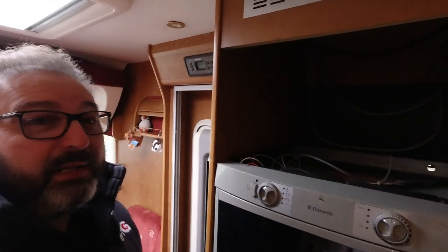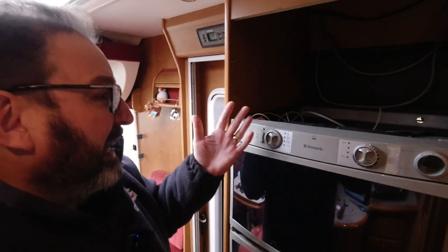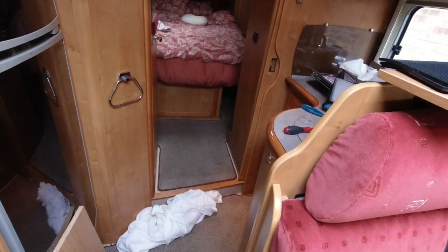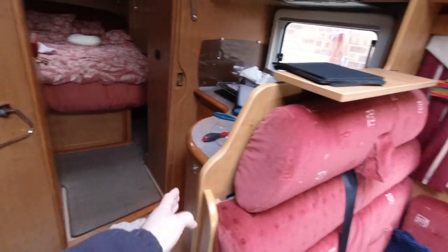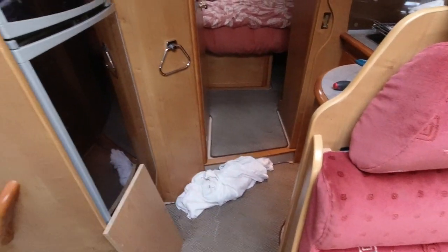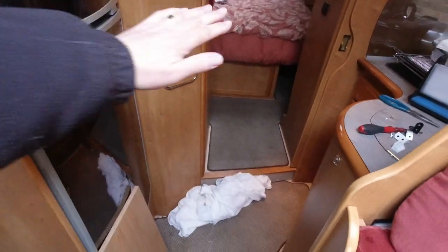We've reached this stage — success! Managed to split the Tech Tower, removing the oven from the top. Couldn't really film doing that because it turned into quite an epic task. We were dragging the fridge out, in our own way, trying to discover how to do it as we went. We achieved the split by taking the whole thing out and doing it outside the furniture. In our van, the Rapido, it's a very tight fit to squeeze the whole unit through. We ended up having to take the front doors off the fridge to get it through the gap, and even then it wouldn't go out through the door without more disassembly, which I just wasn't prepared to do. So we ended up stripping it just there.